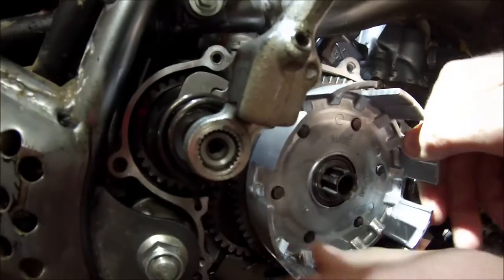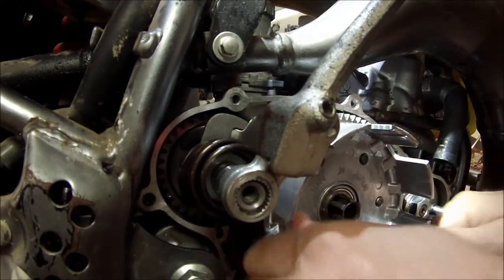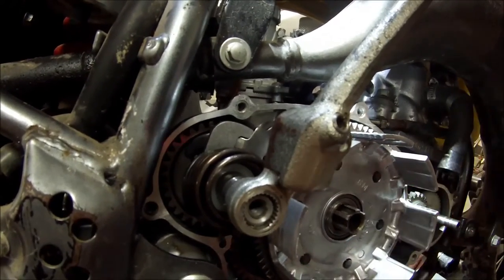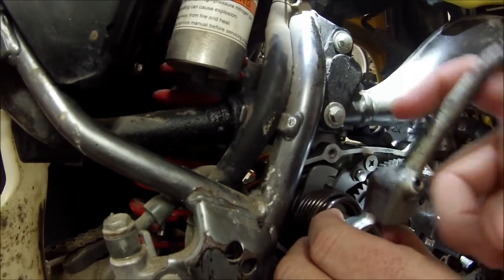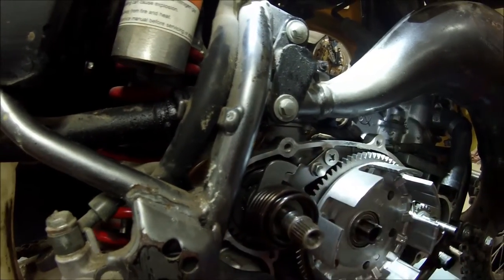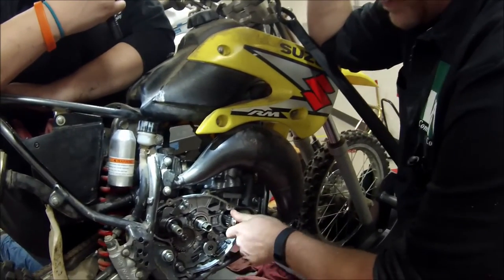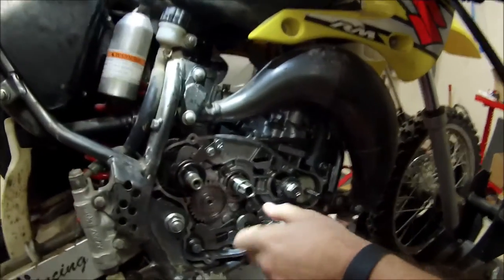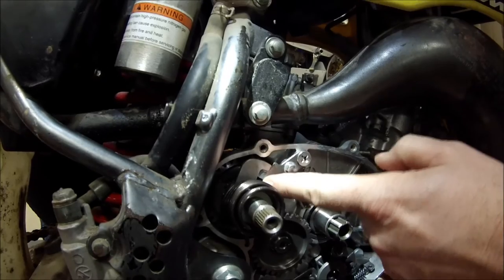When we took it apart, I want you to see what happens — we get to one point and it locks up. You hear that? I go the other way and I find a point where it locks up again. The spring was acting goofy. We removed everything off the crankshaft, isolated it to make sure the crank turned fine — it was good. We checked the transmission independently — fine, no problems on both shafts. But this was jamming and binding on us.